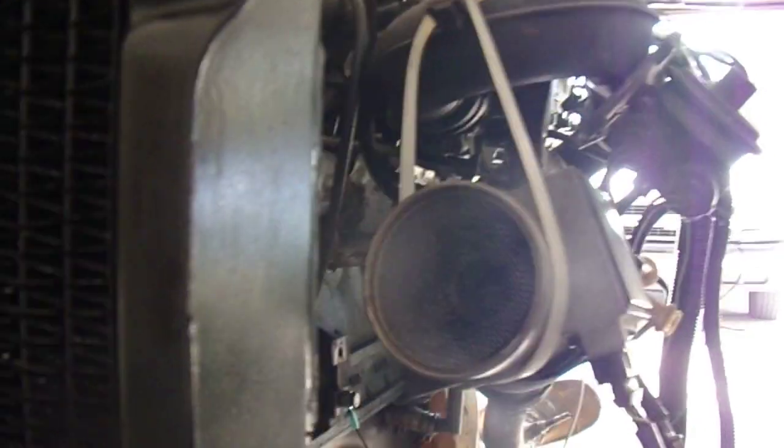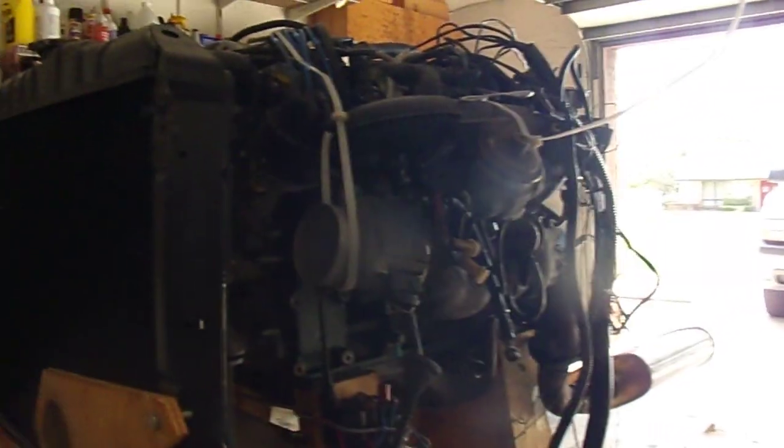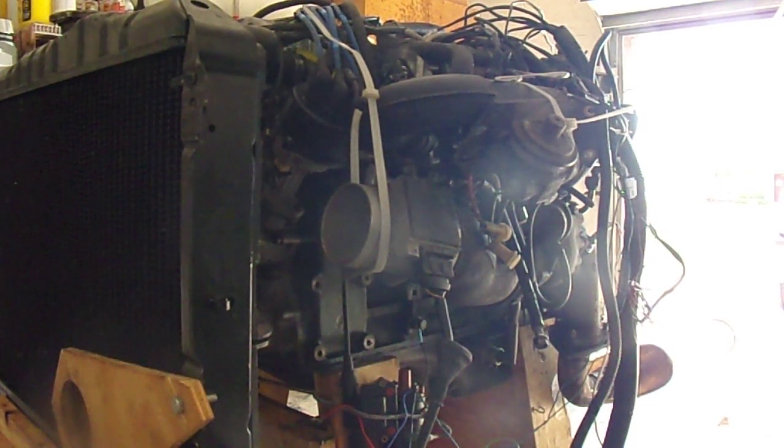I'm not too worried about it. Well, that's it, folks. Just wanted to give you an update on the new one. I know I did it before and it worked, so I'm not too worried about it. But there you go, that's the run with the new harness, including a little bit of troubleshooting to get that cylinder head temperature sensor worked out. It was a little flaky, but the DeoxIT seems to have cleaned it up, and then I cleared the codes and it seems fine.